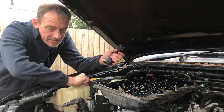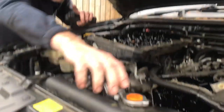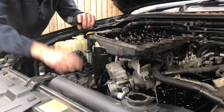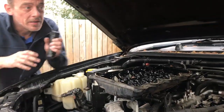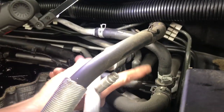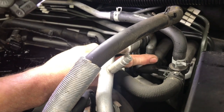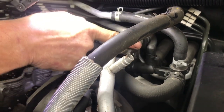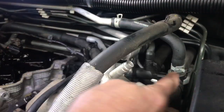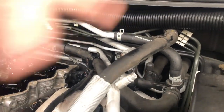When you've done a full engine rebuild and you want to put the coolant in, you need to take both the radiator caps off — this is where people go wrong because they're not aware of it. Get both radiator caps off, and then you have to go for the bleed nipple. See that clip there? Get that off and you'll save yourselves loads of problems, because when you're putting coolant in here you're forcing air into the system, and that's where you get air trapped, which will then struggle to circulate around your engine.